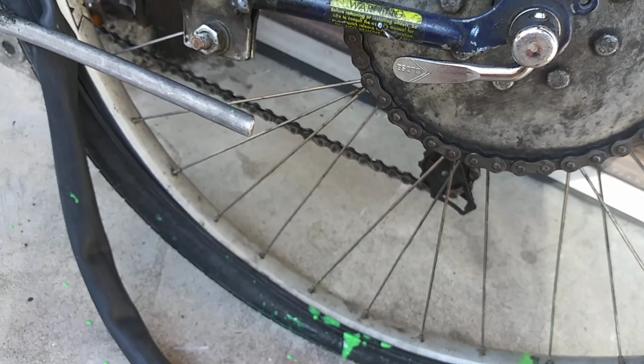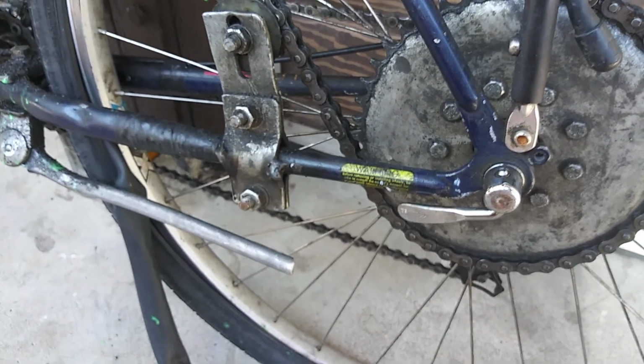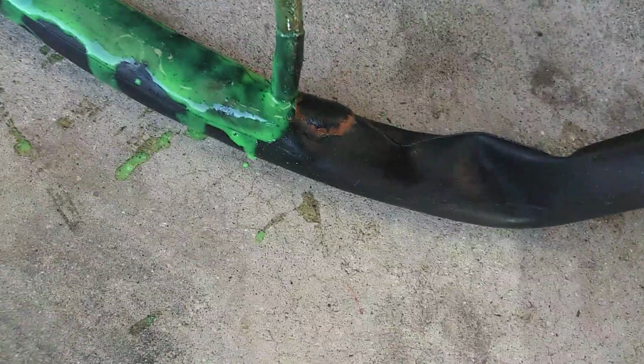I usually carry a patch kit on me because I know how to patch a tube, but not everyone knows how to patch a tube, because they now have, they've had them forever, the glueless patches. You just press them on. But for a patch like this, you don't use a glueless patch. That's an old school, real bike patch with real rubber cement. And it worked. It worked.